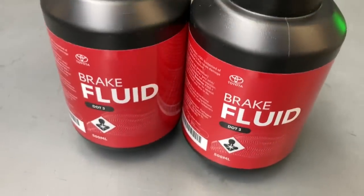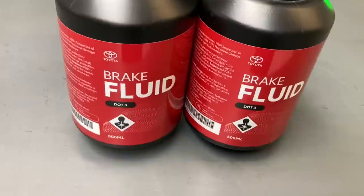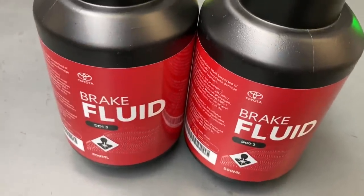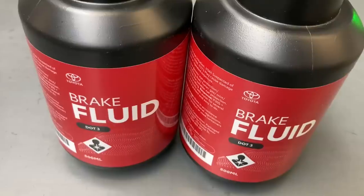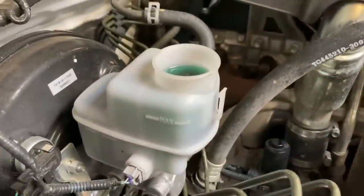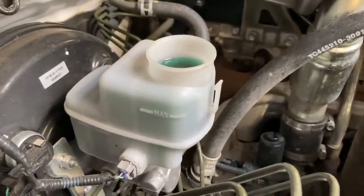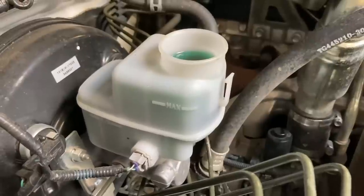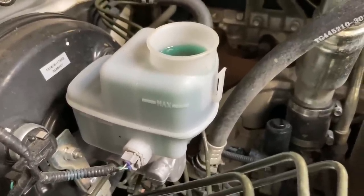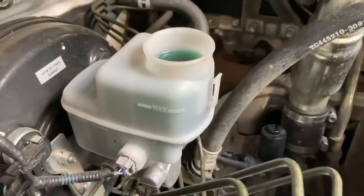Of course, if you're a brake specialist and you're pumping it out, you can buy it in 20-litre drums. You can do that — just keep it clean. Be very careful with it, because if you're adding anything that's got moisture, it's not going to be like a brand new product. Generally, when you change your brake pads or shoes or anything like that, the truth of the matter is you don't need to bleed the brakes unless you've opened up the system and got air in there — which in the case of changing wheel cylinders on a vehicle with drum brakes and brake shoes, then you need to get that air out.